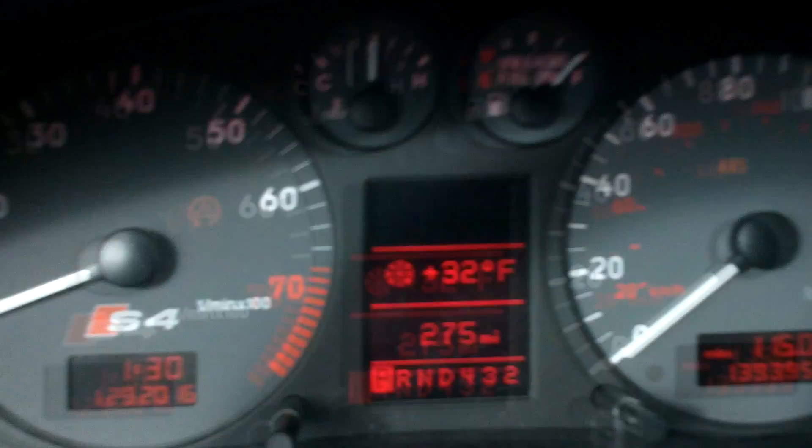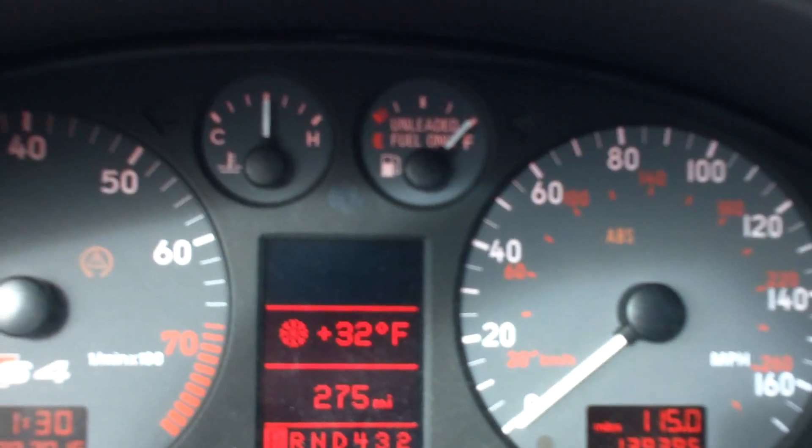After driving a little bit, my flashing brake light did turn off, but I still have those other two lights on. Just the fact that all my other steering wheel electronics are working — the horn, the buttons, the airbag light is now off — because of that, I think that it's a good clock spring.